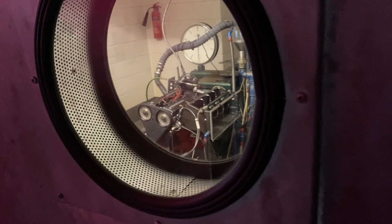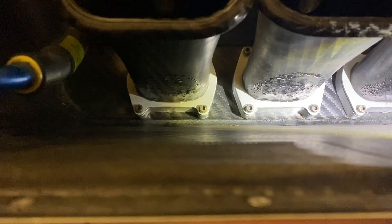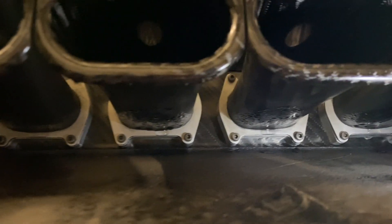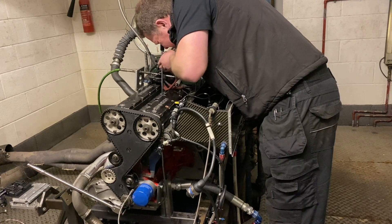What is mega cool - I don't know if it shows up in the video - but if you look just below the trumpets you can see the aluminium plate where it bolts to the throttle bodies. At 4,000 RPM with the fuel flowing in, it's just starting to freeze up with ice because it's pulling moisture out of the air and it's cold. Never did I think I'd see that. We're at about 4,500 revs still breaking in. When we shut it off you can see all the water pooling from where it was iced up - every day is a school day.